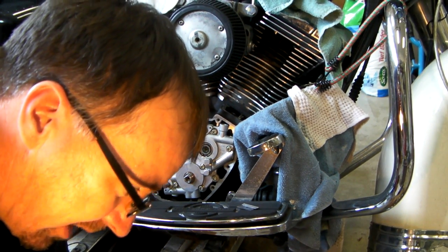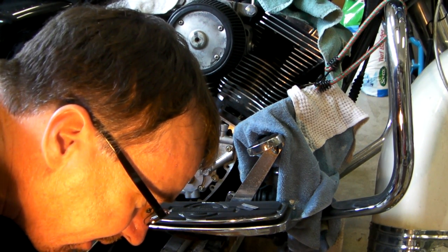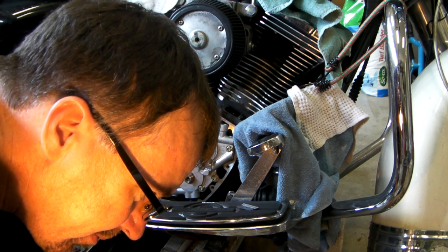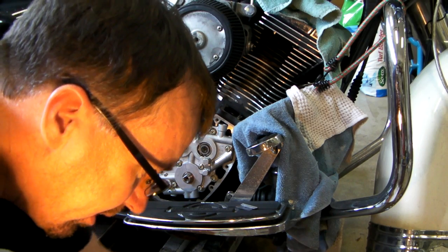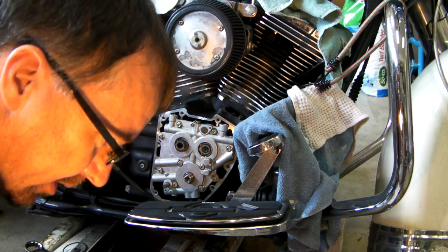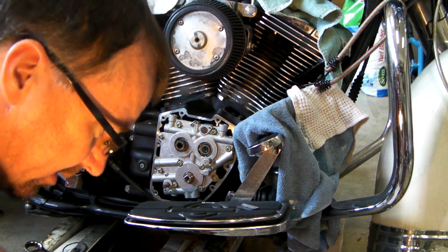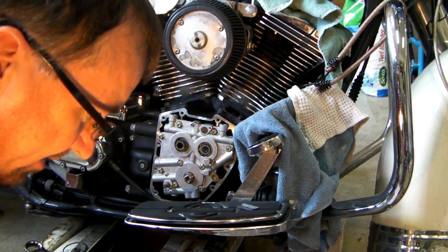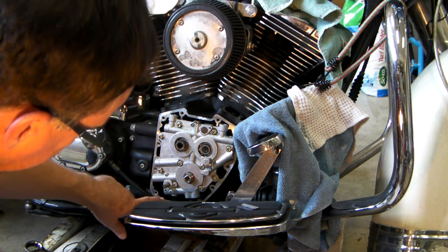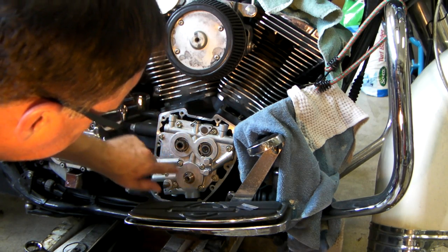It says, while rotating the engine, enabling the pump to find its natural center, tighten the screws until snug. And then when you tighten them for good, again, it's going to be 12 Newton meters, roughly 10.2 to 13.6. It says numbers cast adjacent to the bolt holes also indicate the oil pump torque pattern. So number 1, number 2 cast in, number 3 cast in, number 4 cast in.